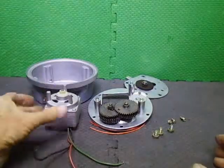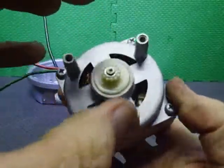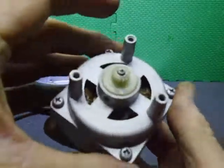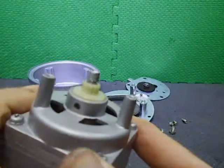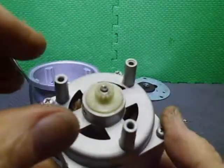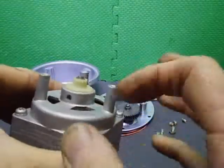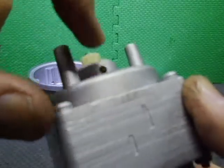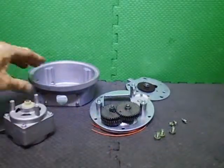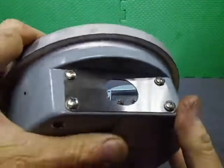We're back. I have assembled the motor and the pinion and the BK brake system and I've run it up. I pre-grease these and then run them up for 10-15 minutes right and left to make sure they're all good, expelling any excess grease. I run a really light grease - I put a bit of excess in there, allow it to spin up and shoot any excess out - all the rest falls to the bottom.